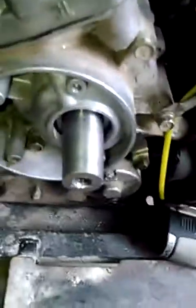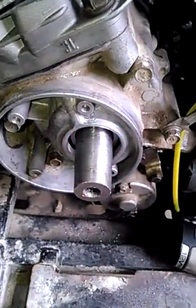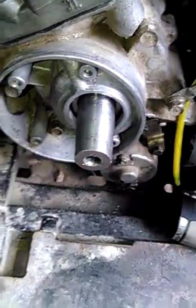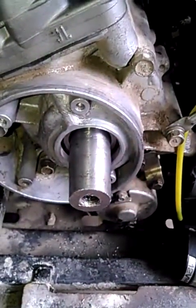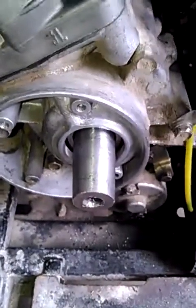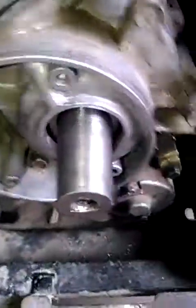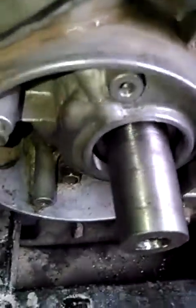So I acquired it, did a leak test on it, and it didn't leak. Put the top end on there and couldn't really get it tuned out very well mid-throttle. I did another leak-down test and pulled the engine over at the same time — it would only leak when the engine was turning. Essentially the guy had the crank seals in crooked; both of them were in crooked and letting air bypass them, which ruined the engine from running lean. The guy wasn't very meticulous — everything had been scratched up and torn up.